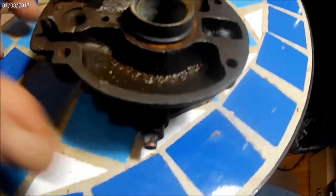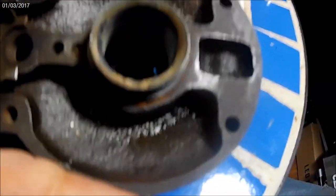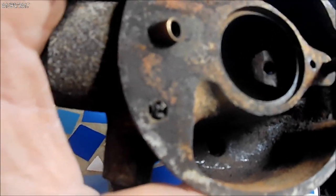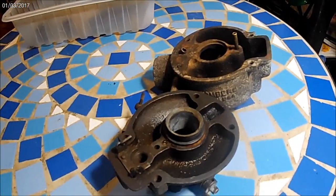This is the last of the ordeal of cleaning the old carburetor. After using the electrolysis I was able to get this jet out — before that I put a ratchet and a little screwdriver in it and it couldn't come out, but after we did that it came out, which was better than before. It still looks dirty and all that, but it's cast iron, so it's not going to clean up like a bright and shiny aluminum one will. That old crust in the bottom down there is not there anymore. I'm going to have to do a little more clean up because I've ordered a kit for it and I'm supposed to get the gasket. Somebody had broken a tap off in that hole and I don't know if I'll mess with that — if you know anything about how hard those taps are, it's darn near impossible to get them out, but I'll try. Once I get my kit for it, I think it's going to be all right. Enough of this monotonous malarkey about cleaning up this carburetor — y'all take care, we'll talk to you later, bye now.